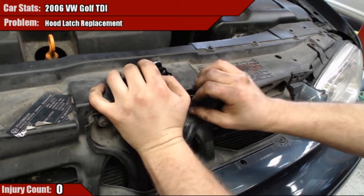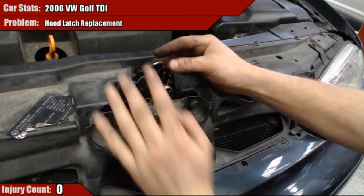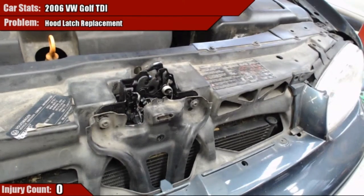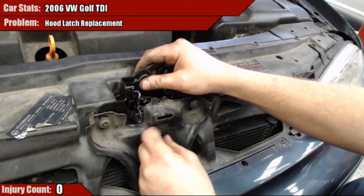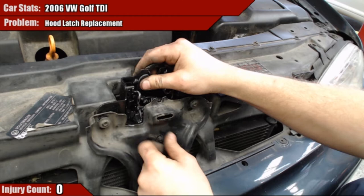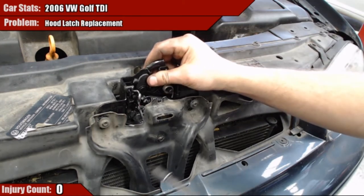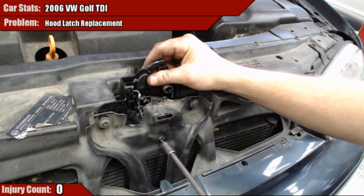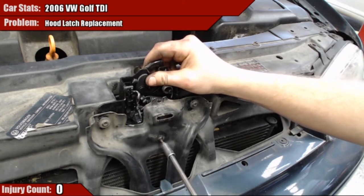So, they have squares in the holes for the hood latch because we need to be able to adjust it as necessary to appropriately accommodate the hood. So while we're testing it, we're going to probably leave this hood strap or something. We need to leave something there so that in case it gets stuck, we're not screwed. So first we'll start with it as high as we can get it to go, about right there, and we'll just start adjusting it down as we get closer to success.